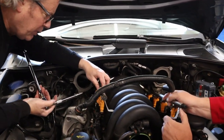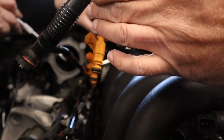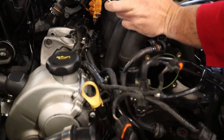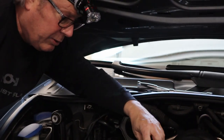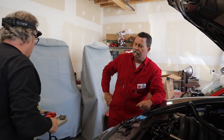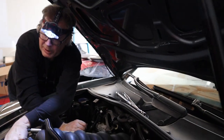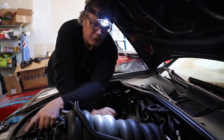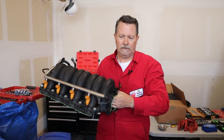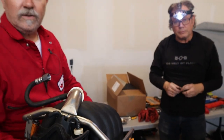The whole reason we've done all of this is to get to this last fitting, which is directly underneath the fuel rail. We just need to position the fuel rail to give us access to that bolt. Now we can put this back down. We're going to remove the vacuum lines from the back and then we'll be able to pull the whole thing out. There are three vacuum lines in the back - two hoses and one clip-style connector that's a little harder to get to. Once you get all three of these out, the whole intake comes right off. There we go - that's our intake out, along with the fuel rail.